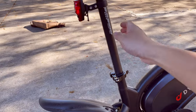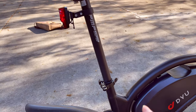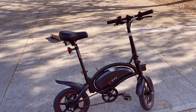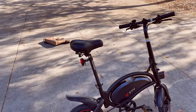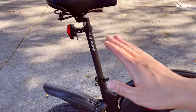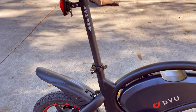The bike comes with an extremely short stock seat post — the first thing you'll want to do as an adult rider is buy a new seat post. The one I have is a 450-millimeter seat post, which brings the bike's geometry in line with any other commuting bike so you feel like you're riding a regular bike. If you don't change the seat post, you're going to suffer very badly. The stock seat post size is 28.6 millimeters diameter. The bike weighs 38 pounds and supports rider weight up to 265 pounds.